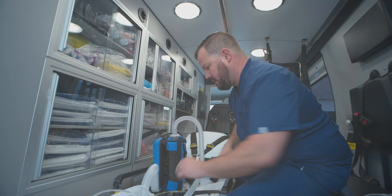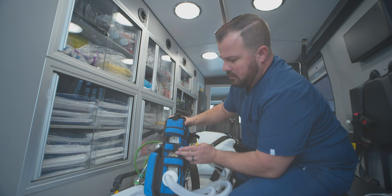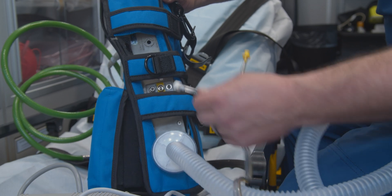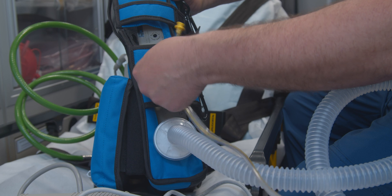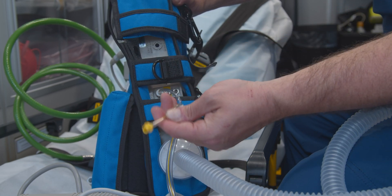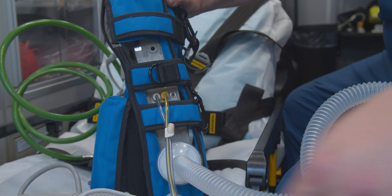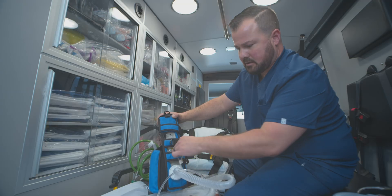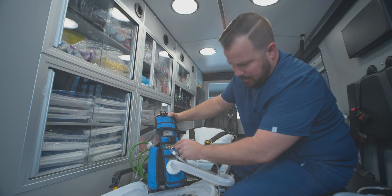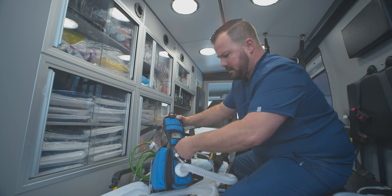On the side here, I'm going to show you how to hook these little tubes up. If you look over here, they're color-coded. Two of them twist and one pops on. What you're going to do is take one of them and counter-turn it — that way it wants to thread on to the right. Put it in here, counter-turn, and now make it nice and snug. Counter-turn back, put it on, nice and snug. Take this one and push it right on. Make sure you get it in there tight, because if you don't get it on tight enough, it'll pop off.